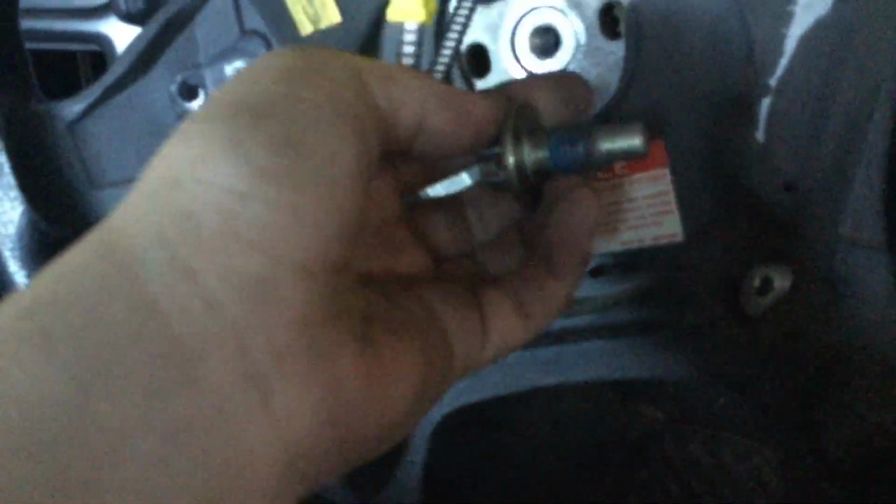Leave it on, because when you go to smack the steering wheel, if it's stuck on the column and you have your bolt off, the steering wheel's just going to come back and hit you in the face, which does hurt, I can tell you that from experience. But mine's all loosened off now, so it should be fine. There's the bolt. Put that in the center console.